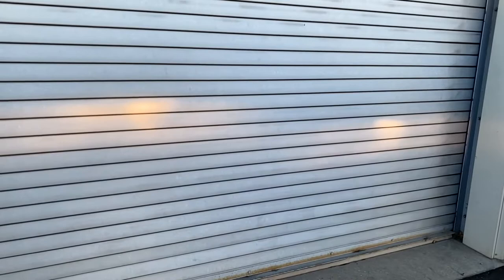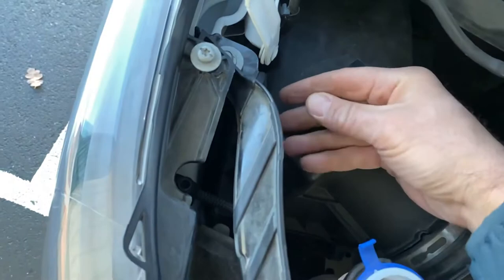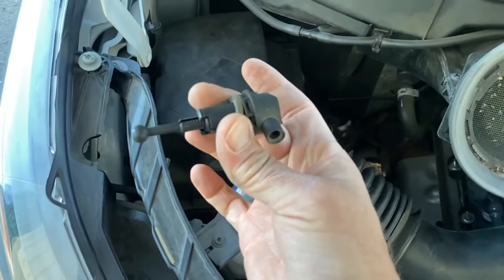On the drive-in today I hit a big pothole and my right headlight dropped out. I wanted to check how to adjust it — right here is the adjuster. I put a Phillips screwdriver in there but it wasn't adjusting. Turns out this actually pulls out — it's a ball socket setup and it's disconnected, so I need to remove the headlight to put it back together.